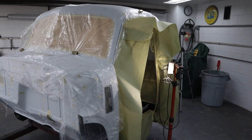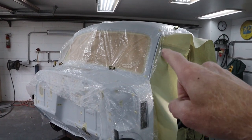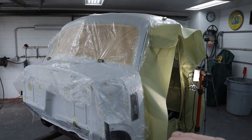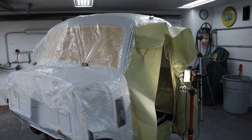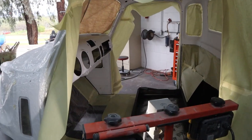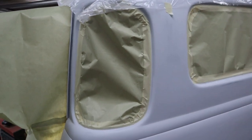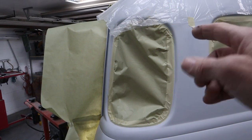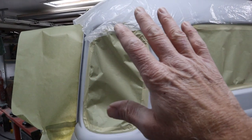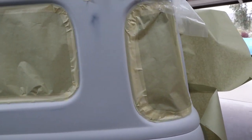Okay, I got everything masked. That actually took quite a while, longer than I thought it would. We've got some plastic draped over the top of the cab and on the front here — I've got a couple of magnets holding it on and some tape here and there. I just don't want that clear to settle down. The black I'm not too worried about; it really doesn't float around. But that clear stays sticky in the air for quite a while, so I don't want to have to go back and redo a freshly sanded surface. You saw me in the time lapse where I tape the paper up there, take a Sharpie from the back side, cut out that shape with scissors, then put your masking tape with the sticky side facing in and reach from the other side to stick it. It works pretty good — not foolproof, but quicker.